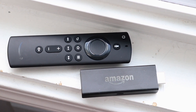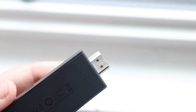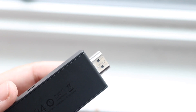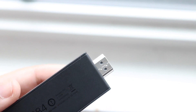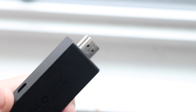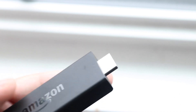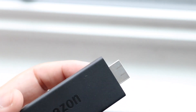If your Amazon Fire Stick is not turning on at all, I would recommend changing the micro USB cord. Sometimes the Fire Stick itself is totally fine but the power cord may be the issue. Luckily, on the Amazon Fire Stick you can change out the cord fairly easily. If you have a spare micro USB cord, swap it out and plug it in — hopefully that's the issue and not the Fire Stick itself.